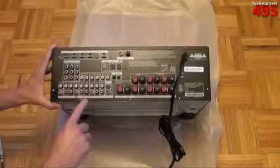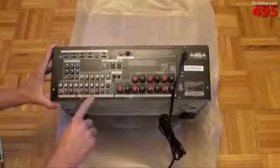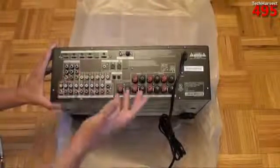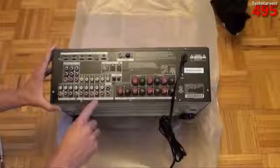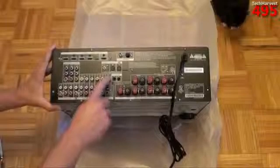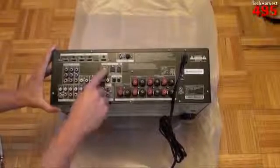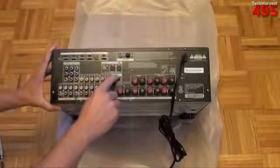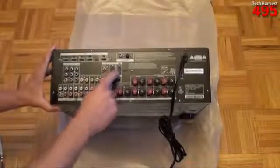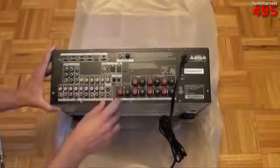You have your full composite cables here. Then you have a SAT or CATV video in here. You have your Blu-ray or DVD in here, and obviously if you're using Blu-ray or even DVD these days, you probably want to use the HDMI. Then you have zone 2 here, which is an out. It's a video out. And you have a monitor out, and you have a subwoofer here. This is the 2 subwoofers that are out. You have a coaxial here for Blu-ray or DVD. And then you have your assignable optical here, and then an optical in here. Now I'm going to be using this optical in from the television set, and that's pretty much all I'm going to use this device for at this time.